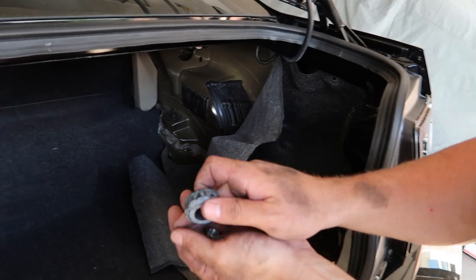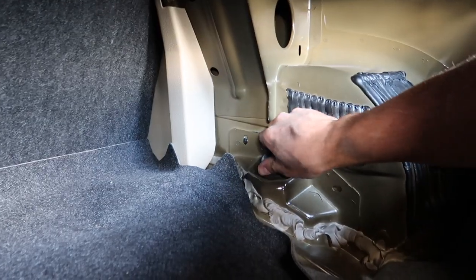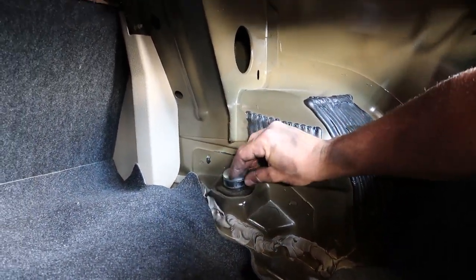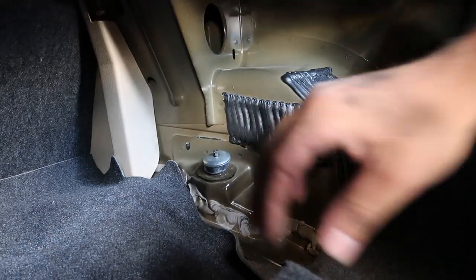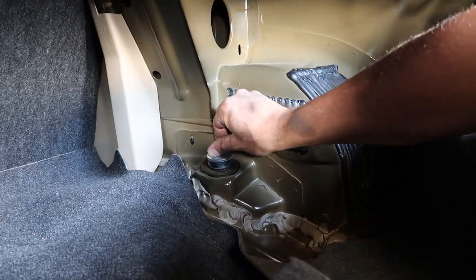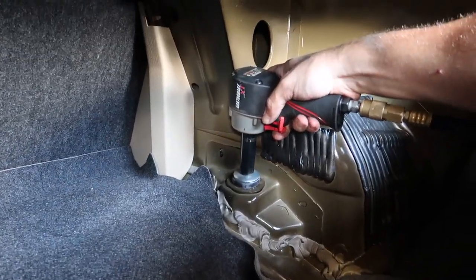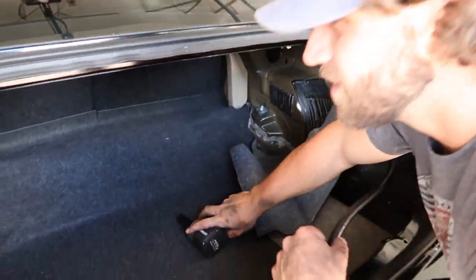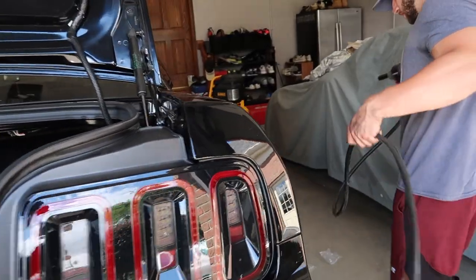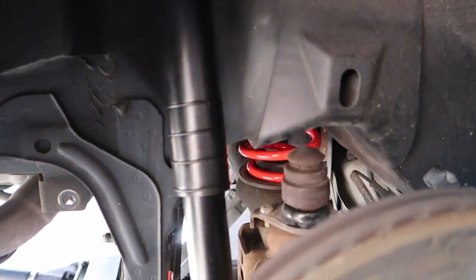Now you're going to put these little pieces on top. There's a little rubber piece on top of the shock absorber, then you've got to put the metal piece on. Rubber this, metal that, bolt this, type this — barely enough room to catch any threads. That's when you get the impact wrench and full send it. Shock absorbers are in, springs are in. Now it's time to put the sway bar and raise it back up.